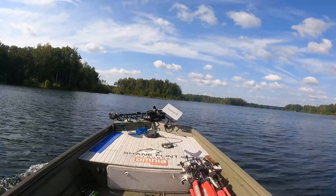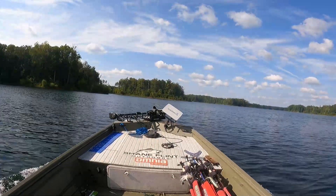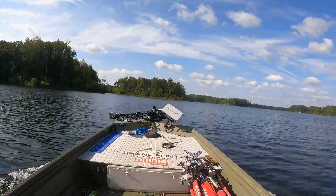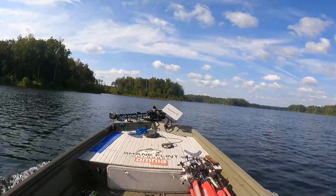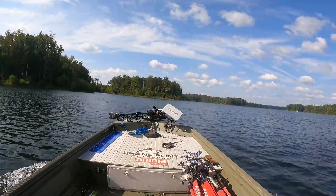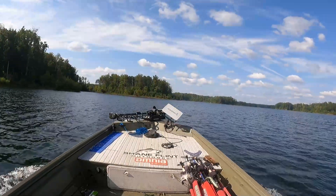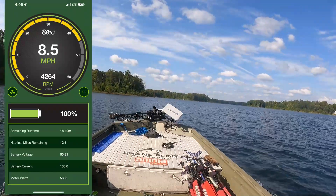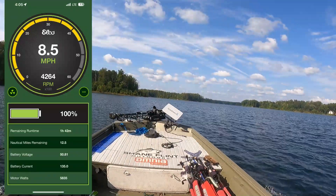The boat is not pushing water at the front like it did with the other motor — much more efficient for sure. We're running right at 7 miles per hour, 6.97, at 4,200 RPMs. We've got 1,800 more RPMs to go, so I'm sure I'll get to 8 or 9 miles per hour once I get the throttle cable in the right hole. And once I did get the throttle cable fixed, I got up to an average of around 8.5 miles per hour.